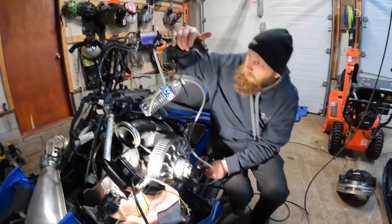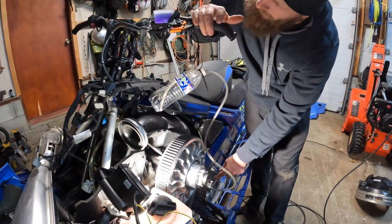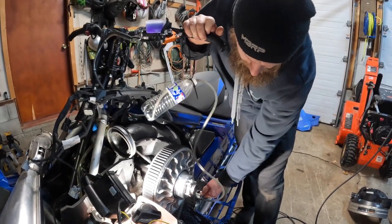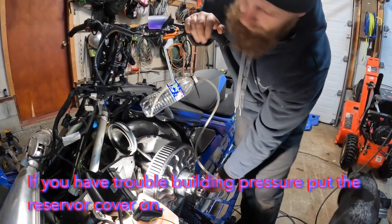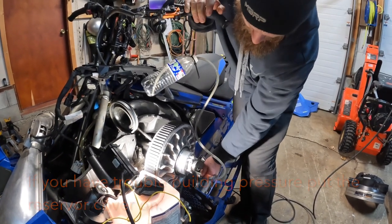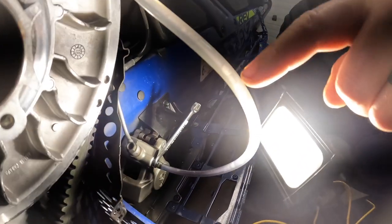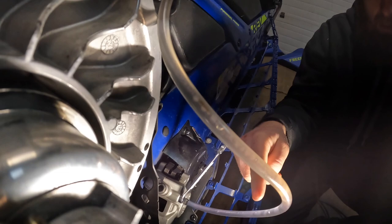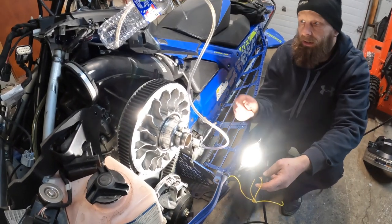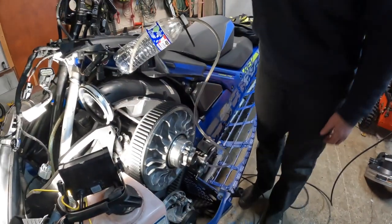What I'm doing is just building up some pressure. Make sure you don't run your reservoir dry - build up a bunch of pressure, hold it, and you'll feel the lever get stiffer. Then as you open it up, you feel it get softer as the pressure tries to cycle through all the older stuff to get all new fluid in there. Just take some time - as you can see, you can see some of the air bubbles in there. That's why we've got this hose hooked up, so you can see the air bubbles coming through. That's what we're trying to get cycled out. Keep pumping and releasing until you don't have any air bubbles anymore.